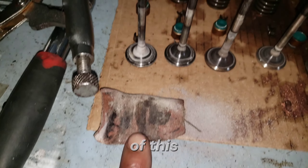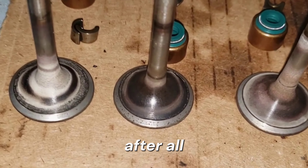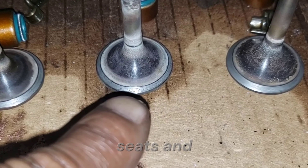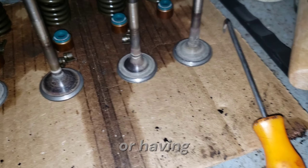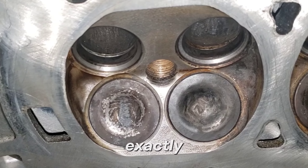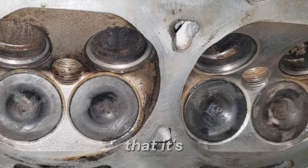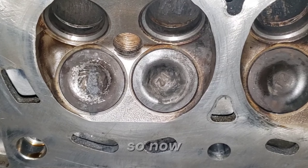Now that I've beaten the sandpaper and really whipped these valves into shape, valve lapping is done. This is what the harder metal looks like cleaned up on the actual valve face — where it actually seats and doesn't let anything leak. I figured I'd make that seating area a little bigger so there's less chance of it leaking or having to go back into the motor later. That shiny part is where it's going to seat now. Instead of an extremely small seating area, it'll seal better — better compression, more power.